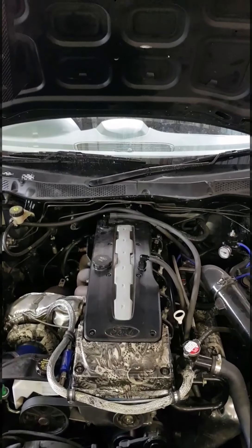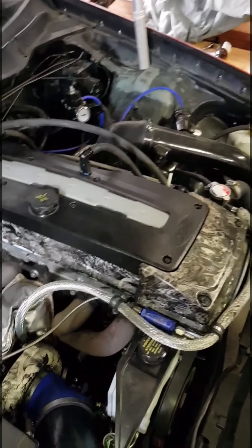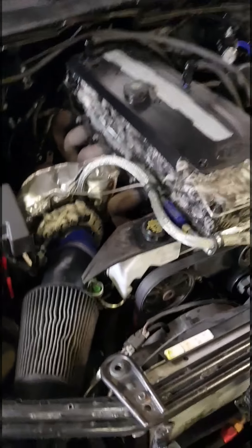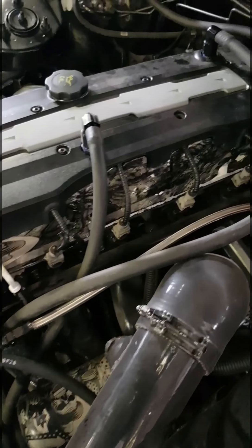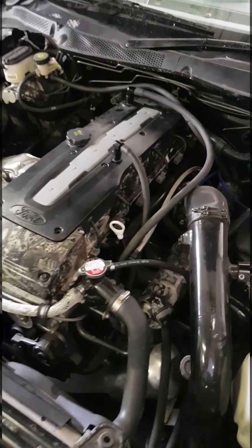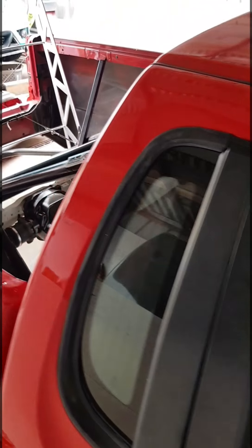What we have here is pretty typical of what you find underneath the bonnet of an XR6 Turbo. This is a Barra 4-litre — they came factory with a small turbocharger running around 200 to 220 rear-wheel kilowatts. We're still running the factory turbo, we've only done an exhaust upgrade and a wastegate actuator upgrade. It's got a larger intake, we're running an external oil cooler, it's on the FG manifold with an upgraded intercooler, running 1000cc injectors in a Plasmaman rail with an upgraded rising-rate regulator. The only internal mod is valve springs — everything else inside the motor is pretty standard. That's now making a low 400 rear-wheel kilowatts, about a thousand Newton metres.